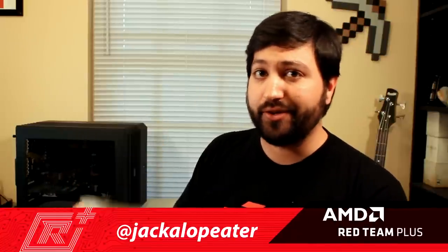Welcome back, it's Keith with AMD Red Team Plus. Today we're looking at changing out thermal paste the right way. Whether you're getting a new heat sink, replacing your processor, or just refreshing old paste, instead of reaching for rubbing alcohol and a paper towel, we're going to use Arctic Clean two-stage cleaning solution — one removes the old thermal paste, one prepares for the new. We'll also apply Arctic Silver 5, and instead of a microfiber cloth, we're using coffee filters since they don't leave any fibers.